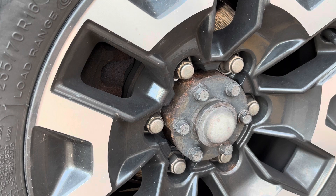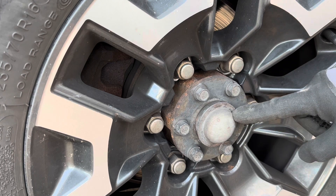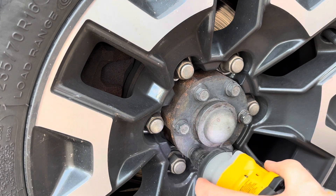To do this, we're going to need to take off this fixed flange, which is 15 millimeters. We're going to need to pop the grease cap off and then get off the keeper ring holding in the stub axle in there.